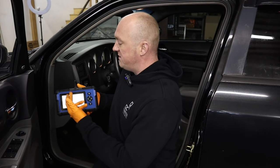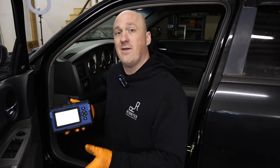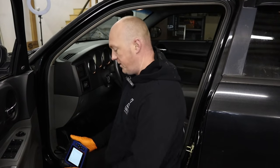Here's how this test is going to work — we need a baseline. This engine is a 2005 Hemi Magnum RT with 126,000 miles on it. We're going to fire this engine up cold; the ambient temperature outside is 49 degrees. Using a scan tool set directly on the oil pressure sensor, we'll read oil PSI at idle and at 3,500 RPM, then bring it to full operating temperature and take those readings again. Then we'll swap in the Melling high volume oil pump, and finally the Hellcat oil pump.